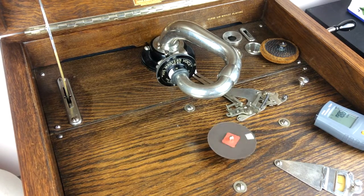A difference of 0.4 rpm is not significant at all. I maintain that you can set the speed using readings from the spindle, or even with just the turntable under load. However, there are conditions for getting accurate readings in those situations: the sound box must be well set up, the needle must be new, the record clean, the spring clean, the motor well set up, and particularly the motor must be a good strong one.